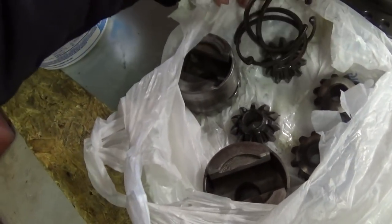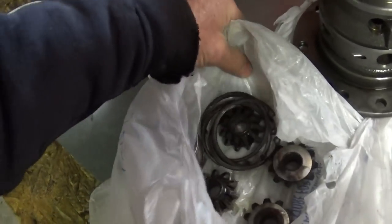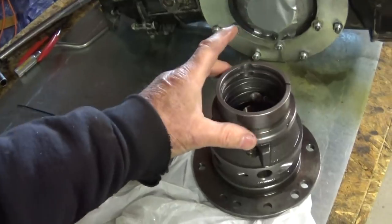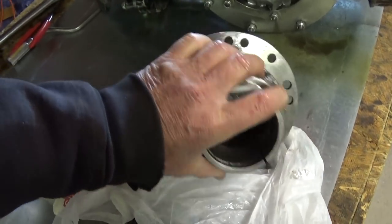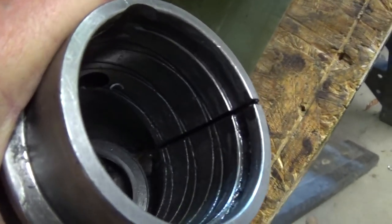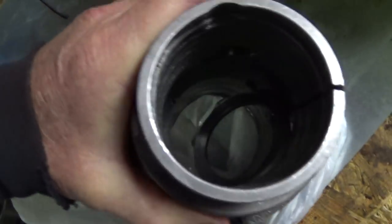There's another ring that goes in there — must be laying around the shop. I'm at my friend's house; luckily somebody had a garage and let me work in it. In order to get the bearing to pull off, I just about broke my puller — and I've used that thing for years. The only way I could get the bearing off to pull the ring gear off was to take a Sawzall and cut a groove right down inside the metal, almost through, without getting into the bearing since I don't have spare parts.